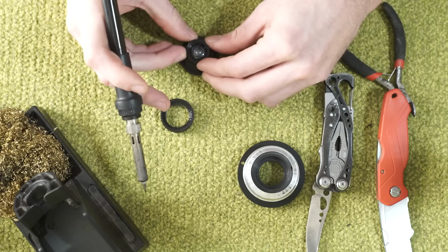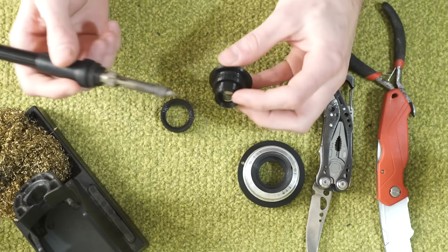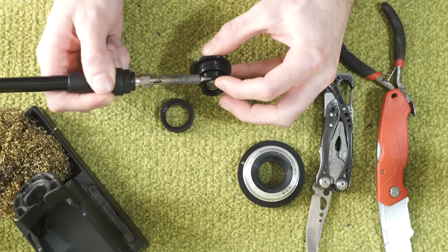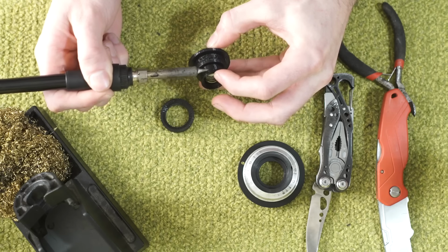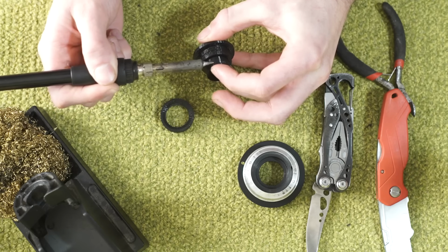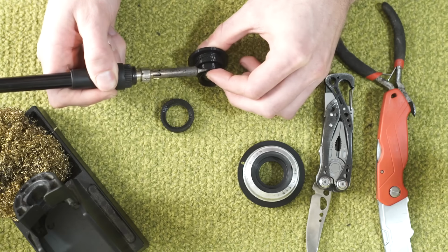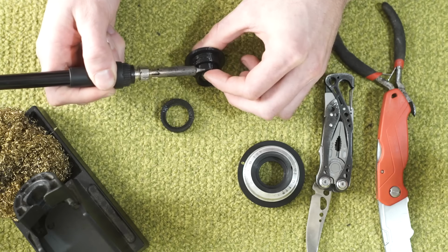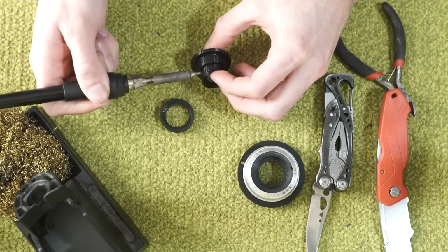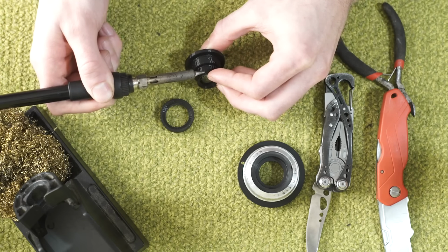Check, make sure my alignment feels right, looks right, measures correctly if you want to be that precise about it. But just be aware that nothing in this process is that precise. If you're seriously concerned about decentering and off-axis issues and the lens not being perfectly level with the film plane, this is not a project for you. You could probably do it far more precisely than I am, but there's no fun in that. We want to go out and take pictures.